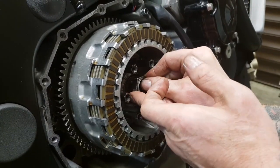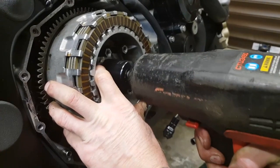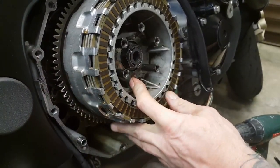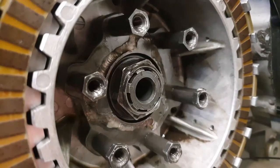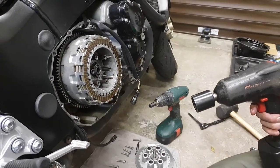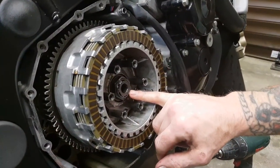Tighten it up with your power wrench. Everything in situ, get the old wrench on it. These tighten up to something like 140 foot-pounds. The easiest way is to get a mate with a power wrench — tickle his nuts a little bit to get him to borrow it. There you go — torqued up. Then just peen over that little section with a flat drift to re-rivet it.